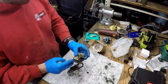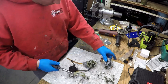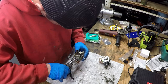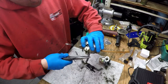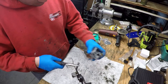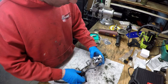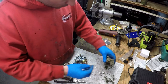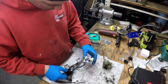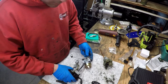Now that we're over at the workbench, we just have the old carburetor here and the new one — we just gotta match everything up. I see now why they gave me four gaskets, because you need four. The new carburetor doesn't have a drain on the bottom, so we don't need that. We'll detach this hose — I hate these little hose clamps, they're just little springs. Spin it side to side, don't try to force it off. Once you've got it off, grab the new carburetor, put it right back on, and don't forget to put your little clips back in. Get all of our new gaskets ready and let's take it back over to the machine.